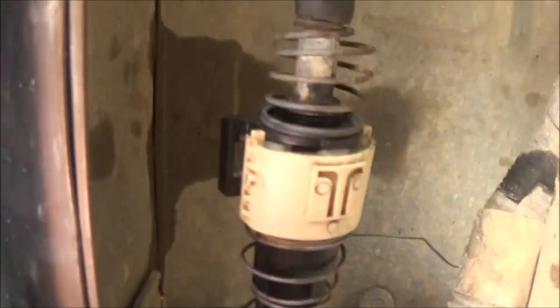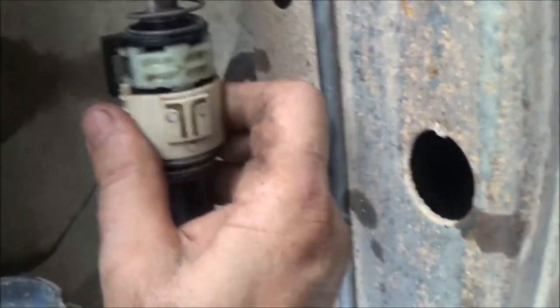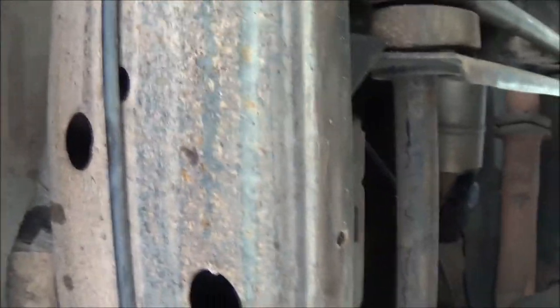Let me show you again real quick where it is — it's on the driver's side right below the door. You slide this back, pull that clip out, go up in the cab and pull it all the way down to low then back in park. Come back down, make sure the shifter on the transmission pushes all the way into park, then put your white clip back down and slide this one back over it like that. That's all it is. It's a hot one! Stay tuned — I'll show you how to put an evap solenoid on this thing. SheaBear — the myth, the man, the legend. See you soon, bye guys!